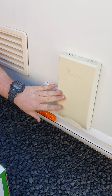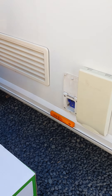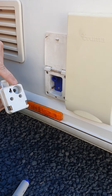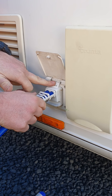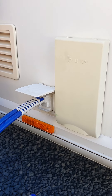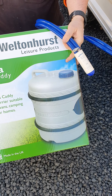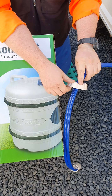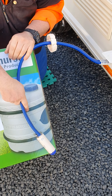Directly behind your outlet, this is your water housing inlet — that little lid flips up. You've got your water hose or water pump hose there. This part can only go the one way, so that part goes with the wee tube there, pushes on, and there's a wee tab that pushes into the groove on the cap. Then you can put that back to 90 degrees, which helps lock that pump housing in place. You then get your water barrel — this is the actual pump part of the hose. Take your lid off, drop that right into the bottom of the barrel. You have a dust and leaf cover which sits in place of the cap. Once that's in the barrel, you can go inside and turn your water pump switch on, and you should have fresh water ready to go.